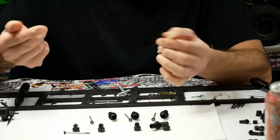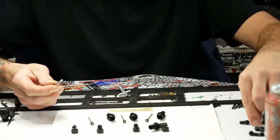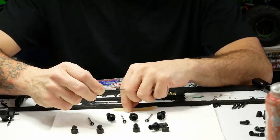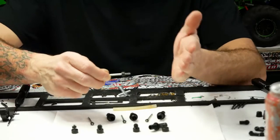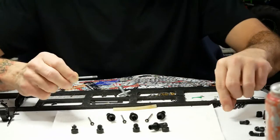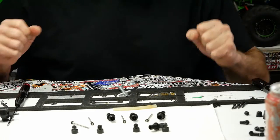You can do it like it was done stock. This truck actually had a 5 millimeter bump stop on that side. You can add more to that side. You can add it to both sides. You can control how much your shocks move. So, some very cool tuning with internally limiting and externally limiting your shock shaft.